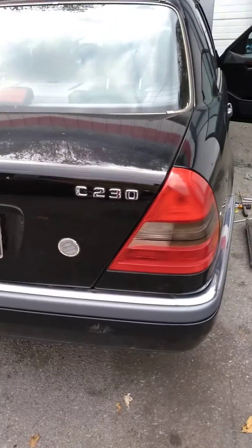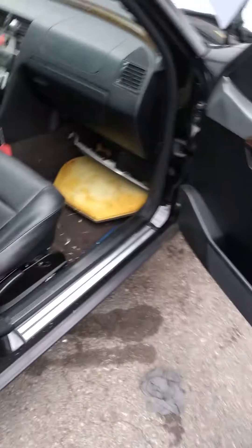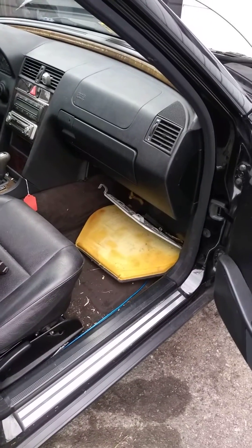So again, we're working on a 97 Mercedes C230. The module is located underneath the passenger side floorboard, and the most common problem with these things is that the connector on the side of the transmission will actually leak fluid through it, and it gets into the wire harness, soaks up through the wire harness, gets into the transmission control module, and contaminates it. A lot of times you can clean them out and run them again. Sometimes they just go bad and you've got to replace them. Anyway, thanks for watching — like and subscribe.